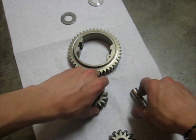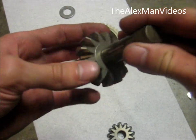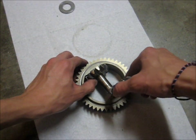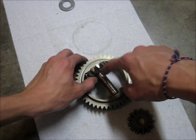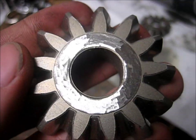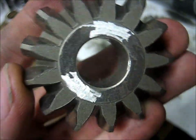Here's the part that's actually welding the differential. Here's the differential casing and we're going to do something similar to what we did before. We're going to grind off this face right here on the spider gears that pivot, and then we're going to grind off a little bit right here on whatever that shaft is that goes in the middle. So if you can imagine how this goes together - we're going to be welding in there. We'll do the same thing to this side once we have the gear in, so we know how everything's supposed to line up. We're going to weld one side all the way around, then put it together and weld the other side in the transmission. The first step is to grind off this hard face. Once we've got that hard facing ground off, we're ready to position it onto that shaft in the differential, then tack weld it and weld all the way around one of these spider gears.